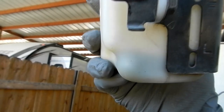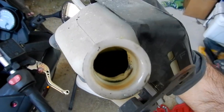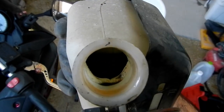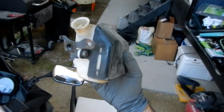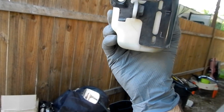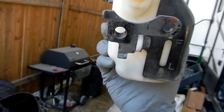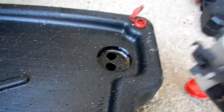There's the fluid — see it? It's right at the L for low. Not good. Holy moly, and dude, it's like black. It's got kind of a rotten smell to it. I guess it's really dark green — I wonder if it was fluorescent green to start. Either way, we clearly have been operating with very low fluid. Obviously the radiator might still be full, but for sure we were low in coolant.